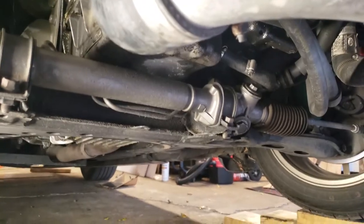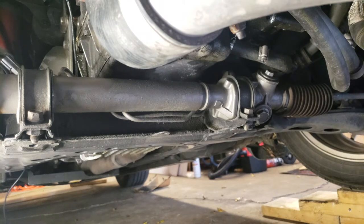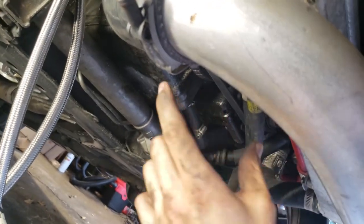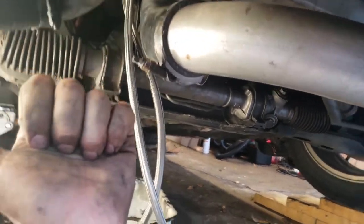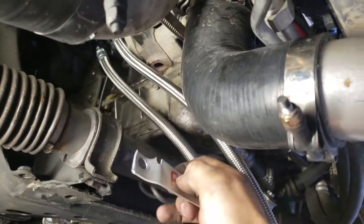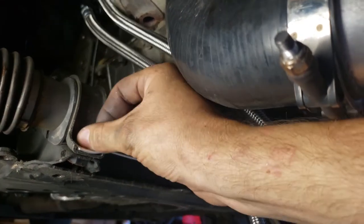The next thing you're going to do is come back under the car and take off these two bolts so you can mount the oil cooler in that spot. I put these lines on to try and test-fit the heat exchanger, and I realized my intercooler piping was directly in the way. It was about over here before, so I had to get a new intercooler pipe — a little longer — and brought that pipe over to the passenger side as far as possible. However, it's still in the way of that mount.